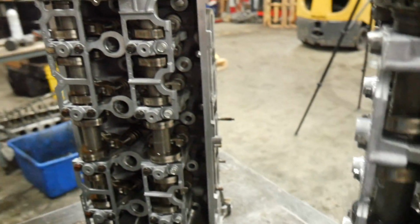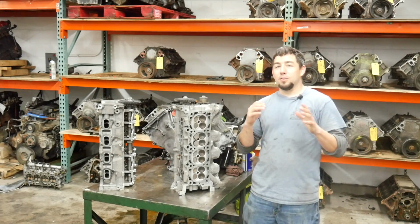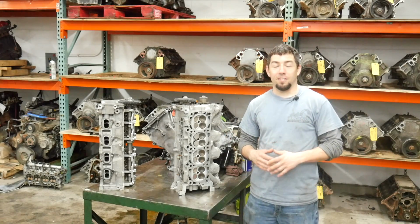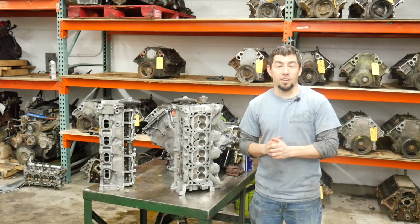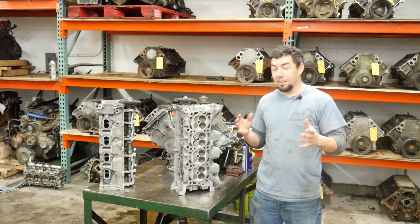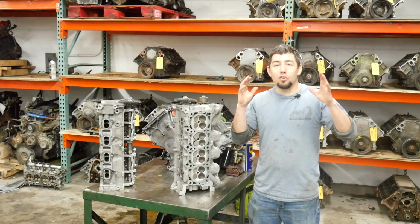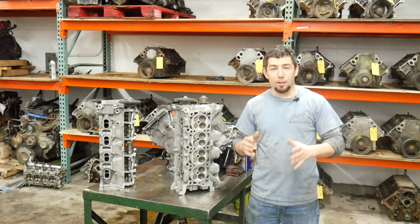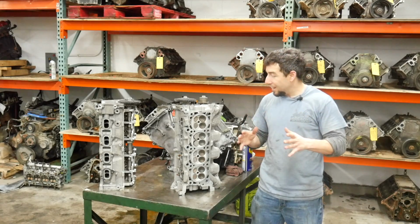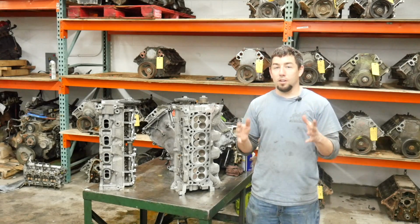This was a surprisingly good engine to take apart. For something that started off so bad, I mean, that was gross and so much corrosion on the outside of that. I bet it was years that engine sat outside. It had no moisture on the inside, like nothing damaged. That piston was at top dead center that had the open intake valves. It could have been so much worse. I mean, the chain that came apart, the pickup could have been clogged. That's the stuff I see most of the time on a 4-valve engine, but not this. This is fantastic. I'm going to have a good pair of heads to sell and a great builder short block.